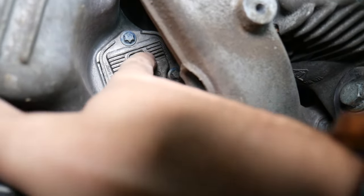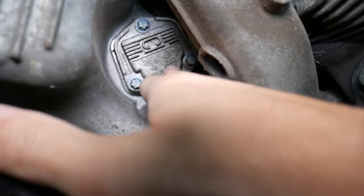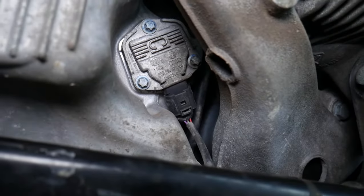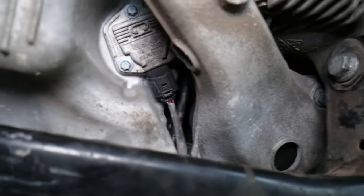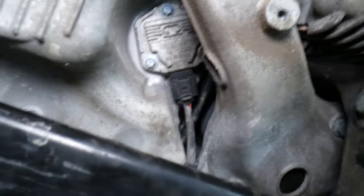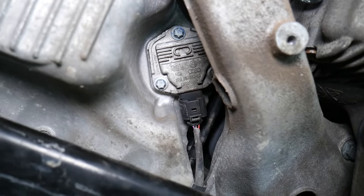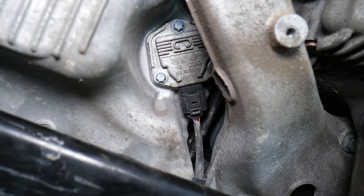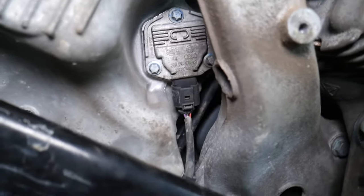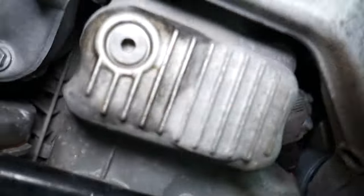If all that checks out, make sure you don't have an oil leak. It's common to have oil leaks from the oil pan, upper valve covers, or the oil level sensor gasket itself. That oil leak can fill the wire connector with oil and cause the sensor to not work correctly. You may get an oil level sensor fault when all you need is to clean it and fix the oil leak instead of replacing the sensor.